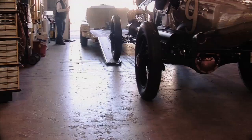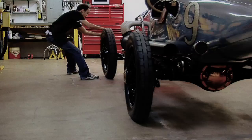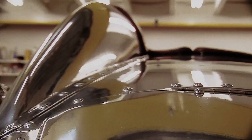When you get the engine out, you do the right thing. In order to restore and get this car back on the road, we have made out a checklist of all the things we're going to need to do. We know we're going to need to remove the body, interior, and wiring. Once we get the engine out, we're going to have to inspect all the bearings, measure all the tolerances, and make sure everything is good and solid. On top of that, we're going to have to fabricate all new exhaust valves, find a new cylinder as well as a piston. If we can't source an original piston, we're going to have to fabricate all new pistons. One of the rocker arms is also damaged, so we're either going to have to source an original or fabricate a new one.